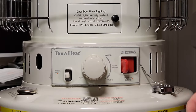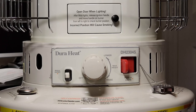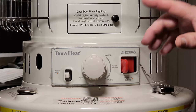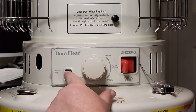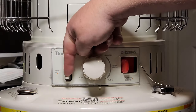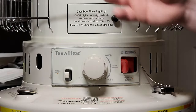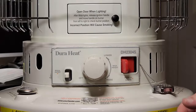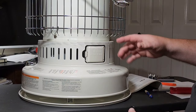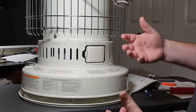If you have any questions refer to the manual. One thing to point out: right here is the manual shut-off. If something ever happens you can shut the stove off by pressing this button. When you hit the manual shut-off it pulls the wick down out of the burn chamber and extinguishes the flame. Always remember that is your safety.